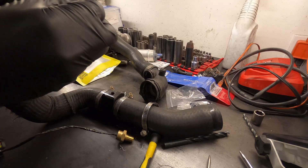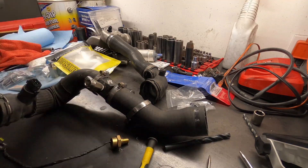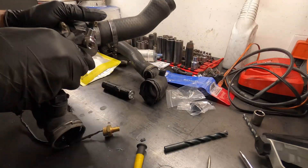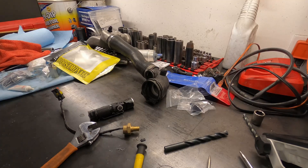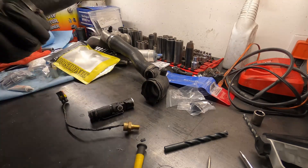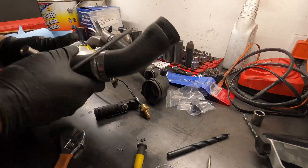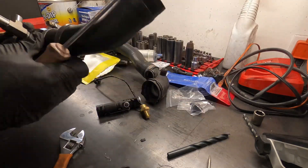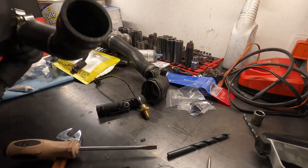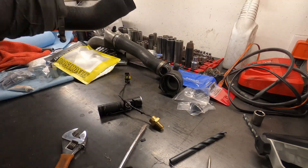It's recommended that you replace the O-rings for the pipes connecting into the thermostat housing if you haven't done it in a while. I had recently replaced mine, so I didn't bother this time. Another common failure piece on the S54 is the factory water pump, since the impeller is made of plastic and it breaks down over time, causing overheating issues. If you haven't replaced it already with an upgraded metal impeller unit, you should definitely do that since you're already in there. I'll drop a link in the description for the updated model.